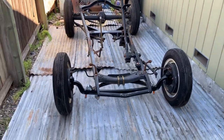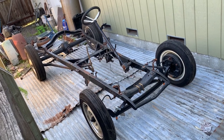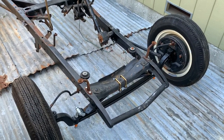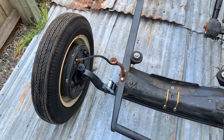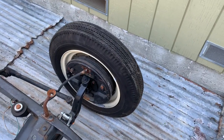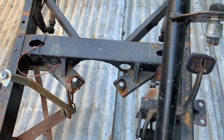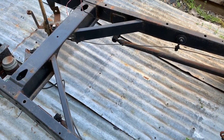I want the back to come down a little bit further. We've got 40 Ford Steelies with trim rings — it's going to run caps. Rear bones are split and bent. I believe that's an F1 steering box. The frame's alright, but it's got some questionable work — I'm gonna have to go over a lot of the welds. The brakes, I believe, are 48 Ford — the juice brakes with the dimples on the drum. Got some Coker Firestone bias ply tires that are actually only a few years old, so they should hold up nice.